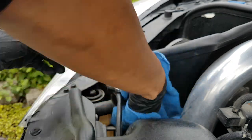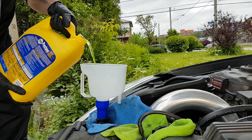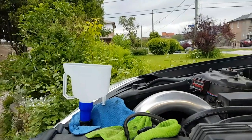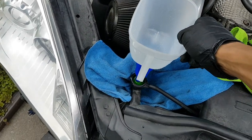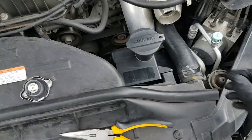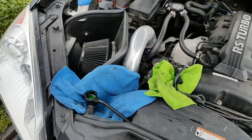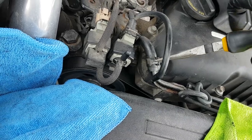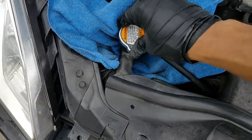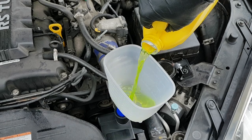Seeing how things are spilling apart when I fill it up with distilled, I'm going to put a microfiber cloth. That's my relief line there. If you feel like this is taking too long, you can start up your car and let your thermostat open up. Keep in mind your fan is off — do not turn your fan, heater, or AC on. Looks like this is all the system is taking, so I'm going to shut off the car right now. Seems like there's no air in the system either, which is really nice. Put the rest of this inside of the coolant reservoir — it's right at full.